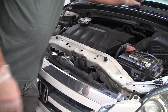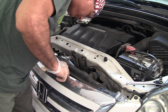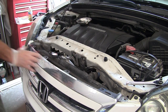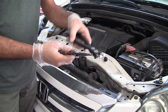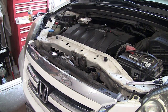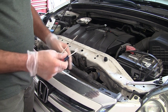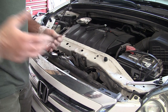When you're removing this panel, there are some clips — three of them that are way down in here and they're tough to get out. I have these clip removal tools, including one that's a little more angled. Worst case scenario if you don't have these tools, you can take small screwdrivers and kind of pinch and pull them out — that's what I had to do on one of them because I couldn't fit the clip tools in. You've got to be really careful because the condenser is right here and you don't want to damage it while taking the panel out.